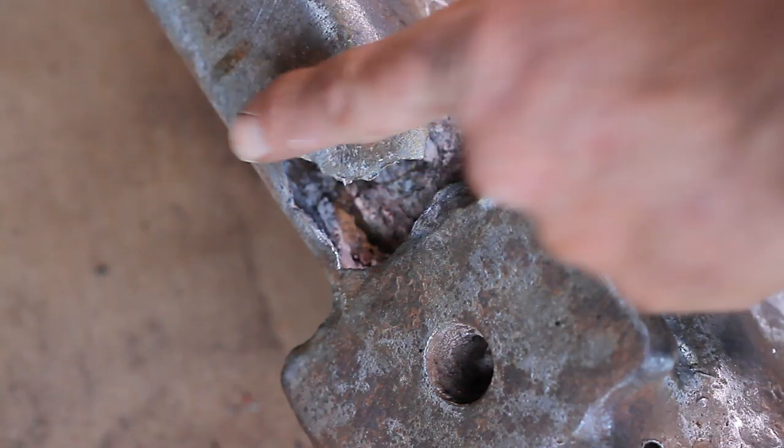If you remember in the last episode, we found these nasty rust holes underneath it in what I thought was either a guard or some sort of a protection for the differential. Folk wrote in an overwhelming number telling me that it was in fact reinforcement for the differential, a thing called a stiffener. Apparently these older axle housings, when worked hard, had a tendency to twist like a pretzel, which apparently is not good. It was ill-advised, folks said, that I was to cut it off.